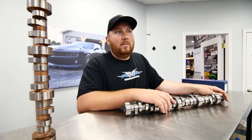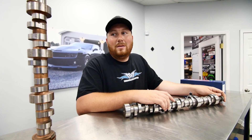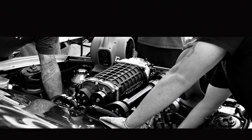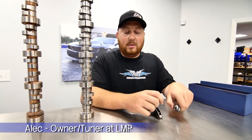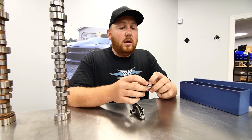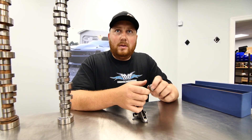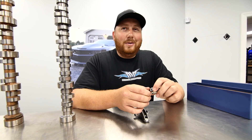That's what everyone sees — yeah, I got this cam, what do you think? And I'm like, well, that's like one piece of 30 pieces of what goes on in your valvetrain. We get a lot of calls about cams because I emphasize it on videos when I'm on the dyno. People call up — for example, they have a 427 2650 build already together, they want to change the cam, they think they can make 1200 instead of 1000. That's not necessarily true at all, and I'm here to explain why.